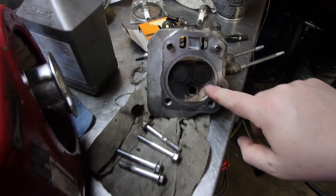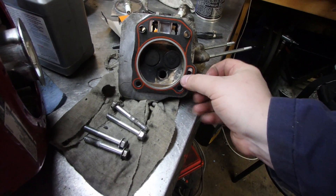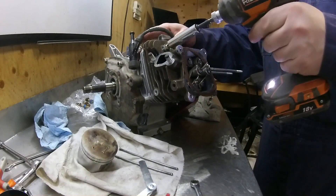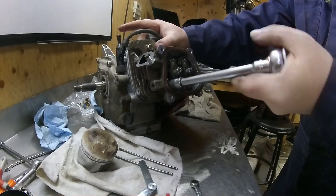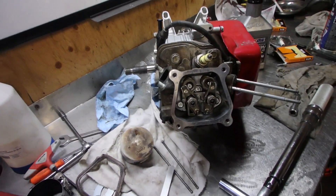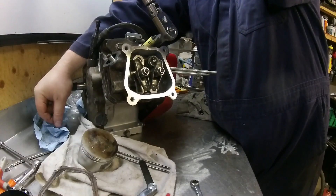We're on the next step — getting the head ready. Here's the head gasket right here. There is only one direction it can go on. This one here kind of felt snug but it's all right. A lot of things I don't torque because once you've been in the trades for a while, you kind of feel when a bolt is tight. But head gaskets are very important — I torque those because if they aren't torqued evenly, there's a good possibility the head gasket is going to be weak at that point and might blow out. The torque spec for this is 17 foot-pounds.